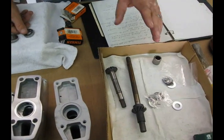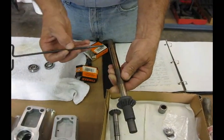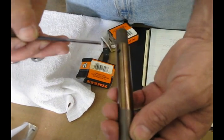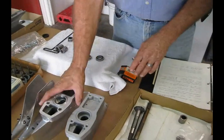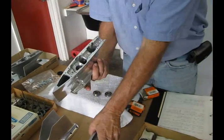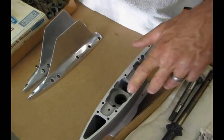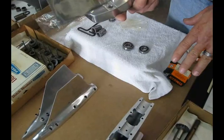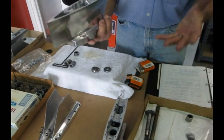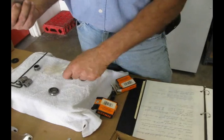When we do all this, the one Achilles heel of that lower unit that will be revealed is that shear pin drive — that's the thinnest part, that's the weakest link. Because once we put a set of oil rifles in here for through oil and bearings, and once we machined this catch area a little bigger, smooth and polished, we send oil up that rifle. I was getting bluing on my shafts — I chased the oil problem out first, got them oiling good, and they still blew up. At the end of the day, it turned out that changing that one bearing ended it.